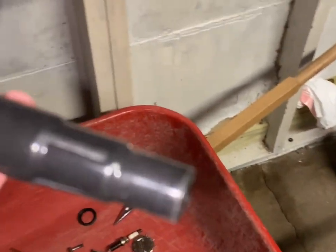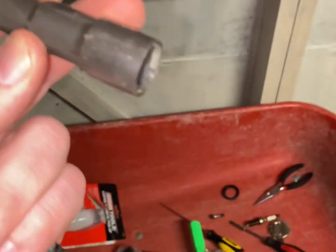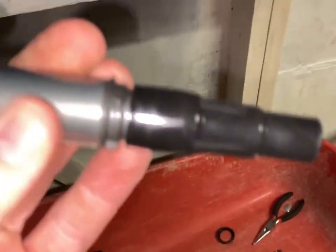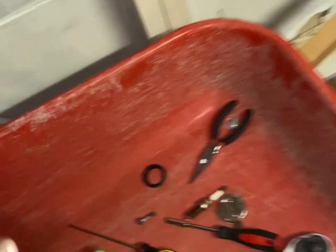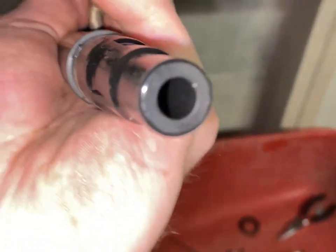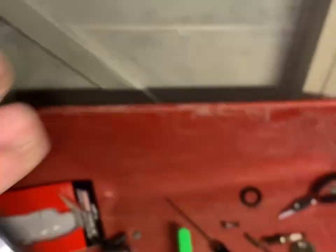I've got to check the boot and see what condition it's in — it's usually standard to replace both at the same time. This is the new boot; here's the old one. It's a little worn out. I don't think it was originally black — they were probably originally gray. There's a little bit of dielectric grease on the side there. It just pops off, though I had to use a screwdriver to kind of pinch it off. There's a small little spring that goes inside that connects in — that just drops inside this housing right here. You want to put that in the housing first, then shove the housing back onto the nozzle, and then this will go right back on our spark plug once we get the new one installed.